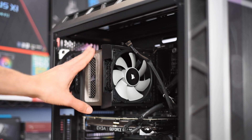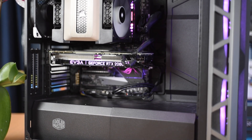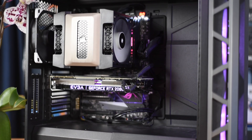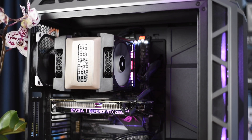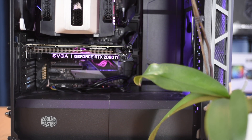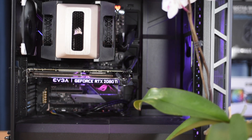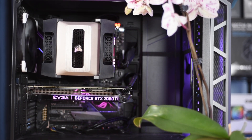The cooler is fully installed — all I have to do is attach my fan cable to the CPU fan header. The front fan does clear the RAM because I was able to raise it with this innovative system. That said, it will be blowing some air above the heat sink, so it may not be at 100% efficiency in this configuration. I'll snap the top panel into position, and the cooler installation is done. Here's the system powered on with the fans spinning — it looks really good with that industrial look that will appeal to people who don't want the blingy RGB look of liquid coolers. As always, I'm Ari for The Tech Buyer's Guru — post any questions below, please like and subscribe, and I'll catch you soon.